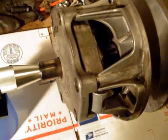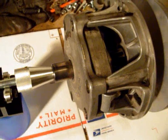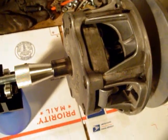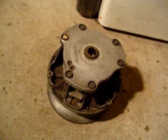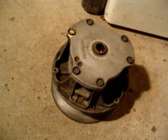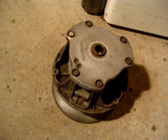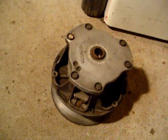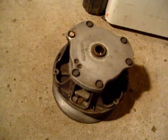You should always make sure that all your fly weights are balanced equally — you can get one of these little gram scales pretty cheap. Your clutch has to be in good working order to have any repeatability in this type of balance. If your bushing is shot, you're never going to get it balanced right. You should be wary of cheap balancing jobs offered on clutches like this. If you do a static balance on a complete clutch without removing anything, it may be somewhat balanced, but if your fly weights are out and the clutch is in bad mechanical shape to begin with, it might not help much if at all.